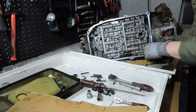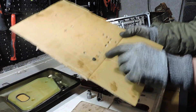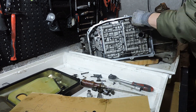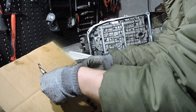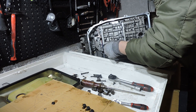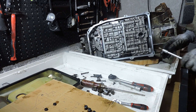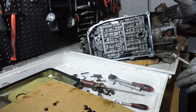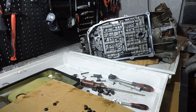With the valve body on the side again, I'm going to remove the bigger head bolts, and with the cardboard right here, putting each bolt exactly back where I removed it. This is a good valve body — I had it measured by a specialist with a test bench. They connect it to a universal connector, put fluid pressure on it, and test if all the fluid pressures and pressure reduction works correctly. If it works, your valve body checks out. Since this is a good valve body I want to keep it — maybe I'll rebuild this transmission again for YouTube purposes, and in that case I want to sell this valve body.